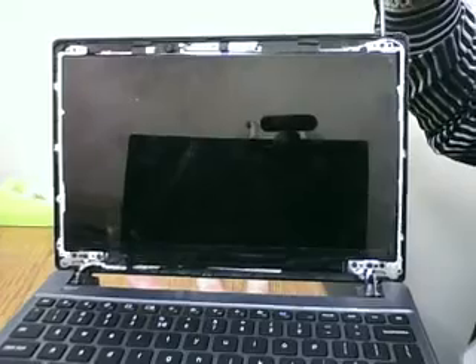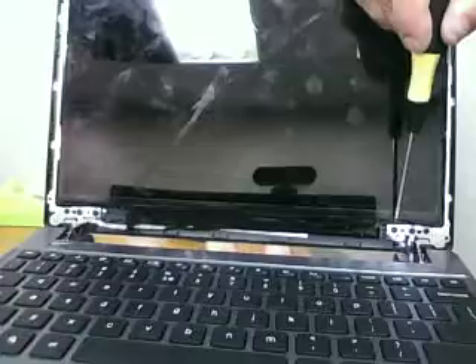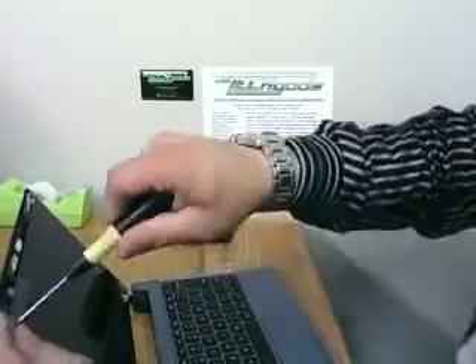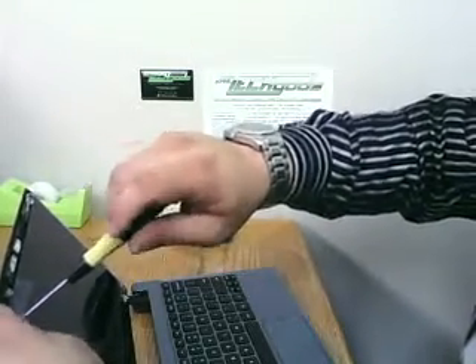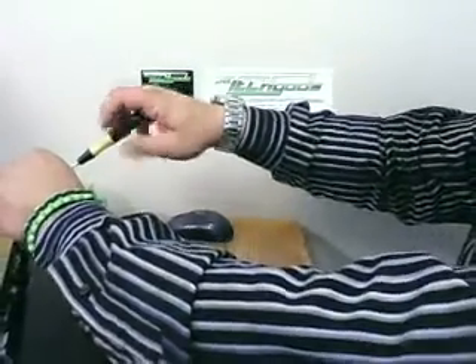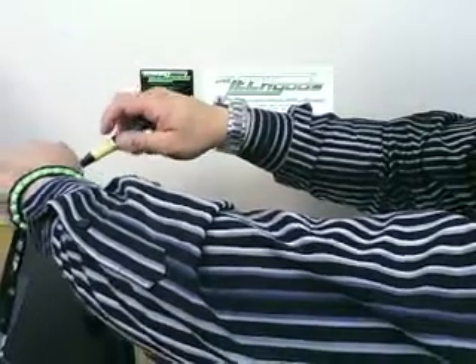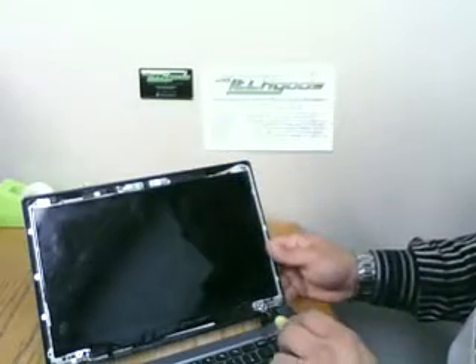You'll see on this we have one screw on the top left, one on the top right. Down along the bottom here we actually have three screws, but only the inside screw needs to be removed — the same applies to the right-hand side. There are two outside screws and then the inside screw; that's the one we need to remove. So those four screws need to come out. You'll notice the bottom left one actually has a piece of sheathing from the monitor cable that goes through it, holding the wire in place — make sure you put it back that way when you reassemble.